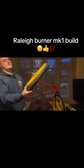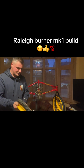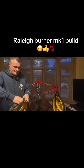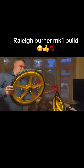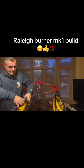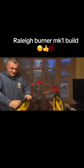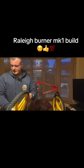So same again as well, put it from the valve, run it round, and try and get one. It gives it a little bit tighter because Skyway, so the sidewall is slightly taller than a standard wheel. Ooh. But they're getting on alright. But then your race tyres, what I use, some of them are a right pain getting onto some rims. So a wide bead, yeah, lightweight wide bead. Okay, it's getting on. Right. There she goes. Try and adjust this one up as I do it, but just use the tyre tool.